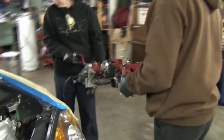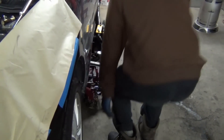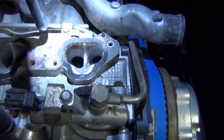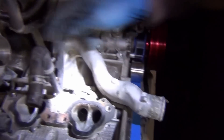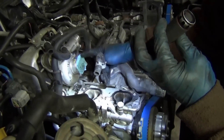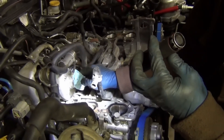Take this and gently place it up underneath the vehicle next to the intercooler. Now you've got your crossover coolant pipe — you can see into the head, you can see the valve stems. This is the line where the head stops and the rest of the engine begins — the block is from here over. You want to be careful not to get any debris into the turbo. What I like to do is take a fresh paper towel and shove it in there — that way you don't wind up with a nut or bolt in there, you don't want to bend the fins. Just tuck it in there gently and any debris that may have fallen will come out with it when you pull it.